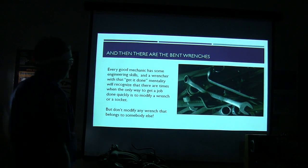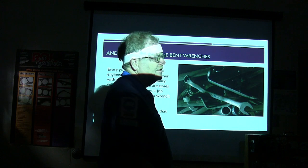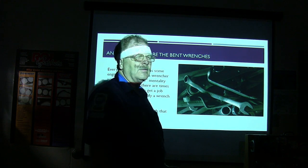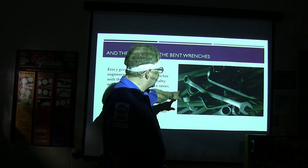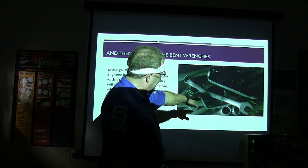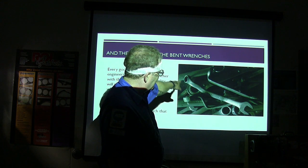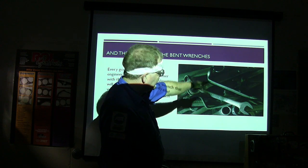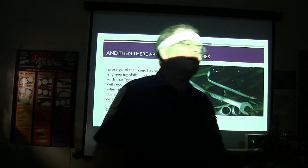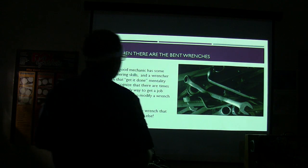These are some of the wrenches I took pictures of in my toolbox this morning. Anybody that's worked on cars very long and is a problem solver knows that if you bend a wrench, you bend the wrench, you cut the wrench — you do whatever you've got to do. I took that one right there and bent it into a Z shape so I could get on a brake line I couldn't get on any other way. In here you'll see sockets I brazed together and stuff that I put together to solve a particular problem.